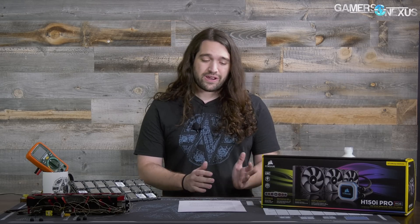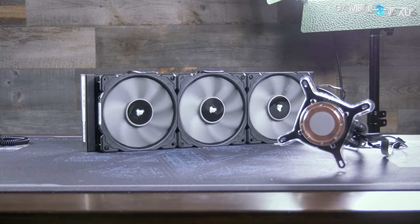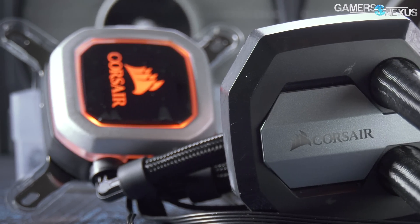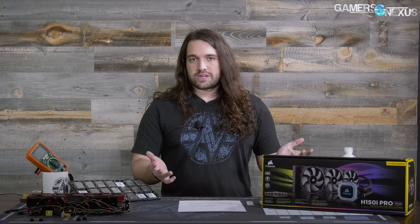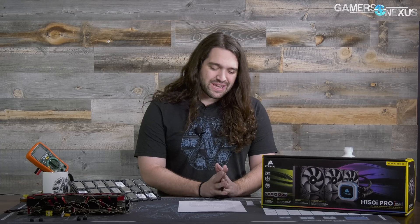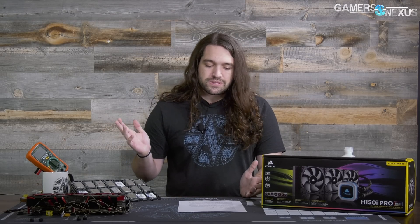Making the cold plate smaller is a somewhat major change for Asetek. They also made the pump housing and block itself smaller, meaning you'll have fewer clearance concerns, though those were never a big issue. The mounting mechanism is slightly changed mostly for the better — instead of multiple drilled through-holes for Intel plates, it now uses a sliding setup to accommodate basically any size. From a modding standpoint this bracket solution is better because you can accommodate things it wasn't meant for, like video cards.